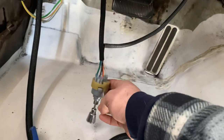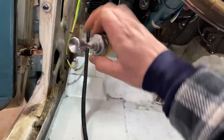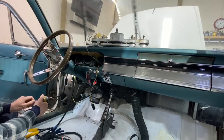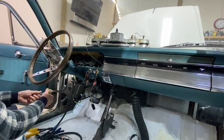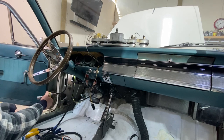She's all wired up — obviously temporarily. Got her plugged in over here. We'll give her a little test hit here. Hopefully we don't let the magic smoke out of the box. I'm not sure if this requires keys on. Well, hopefully it needs power in order to work. Hey — whoa, look, it works! Cool thing too, is the last time when I would shut it off, it wouldn't go back to the bottom. But now I've got my single speed wipers — click them off and they always go back. I'll click them off right there. Hey, they go all the way back.